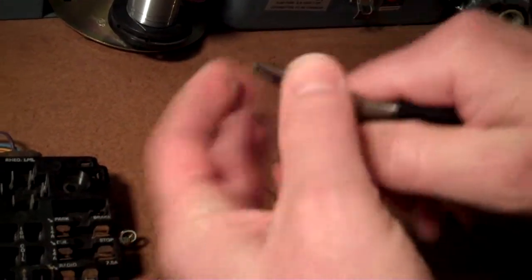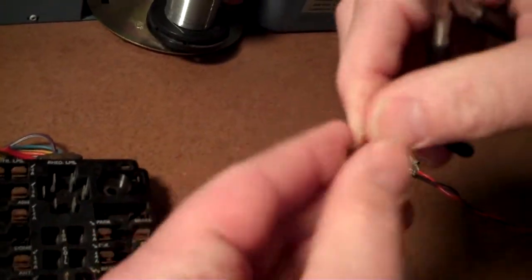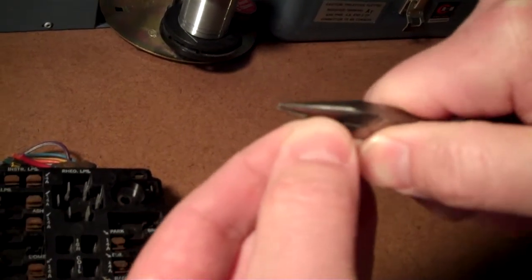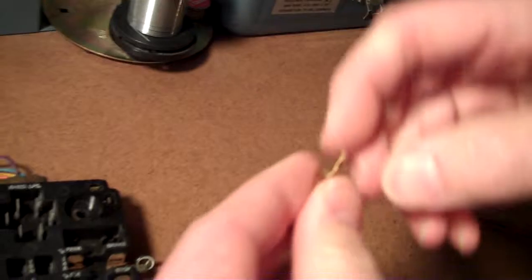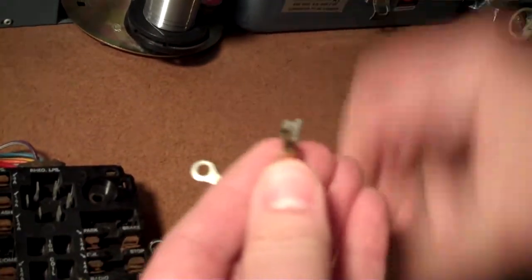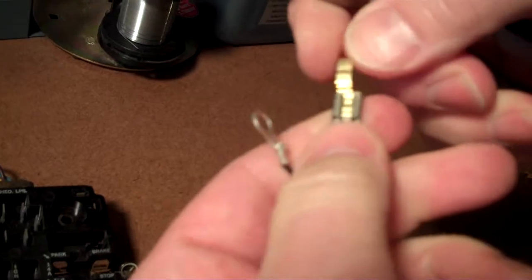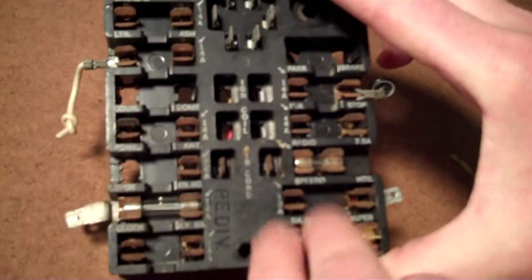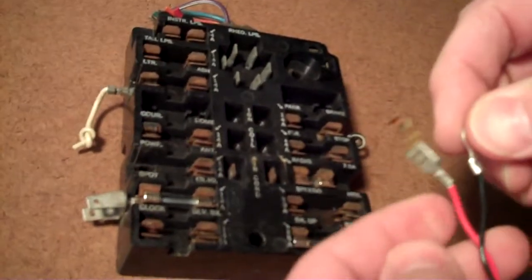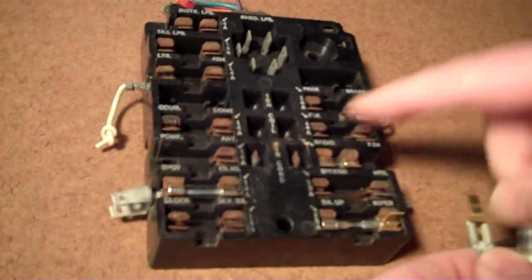Cut off the J — it goes in the garbage, hopefully not on your foot. Then take this and form a bit of a curl. Because this is fairly thin metal, take your Ready Rad power lead and put it on first, so now you've got this ready to go. Head over to your fuse panel. I really recommend using the radio circuit fuse because it's cleaner power — other fuses can be noisier electrically. On AM, since it's amplitude modulation and noise is an amplitude function, you're going to pick up more noise on other fuses possibly.